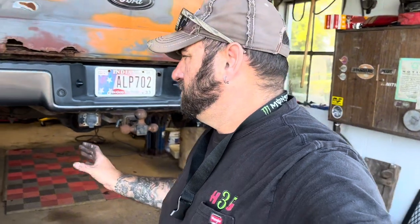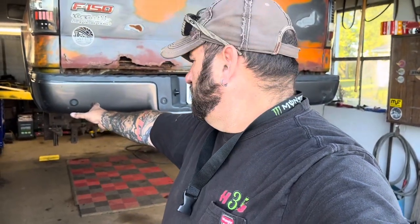And then once you get all the tires back on, one thing I forgot to mention was the first time you press on the brakes, your pads and your calipers, they're going to have to push back out. So the first time you apply the brakes, push on the brakes, let off, and push on them again a couple times until you can feel that the pedal is nice and tight before you put it in gear to move it.